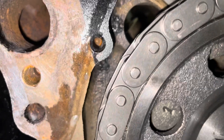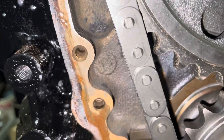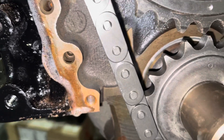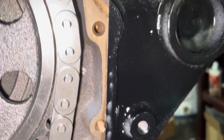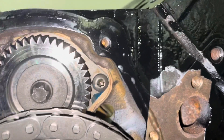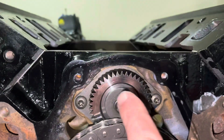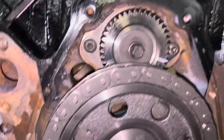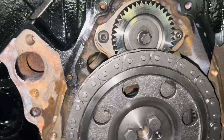There is sufficient flange for the rubber seal to seal against the block, so it will work on this block. You can see it goes right around the outside, around the bolt holes, and it does seal up against it. So I'm going to wipe the soap off, scrape some paint off, and put this Vortec cover on — it should fit this earlier-style engine.